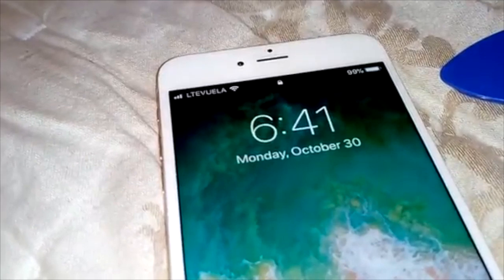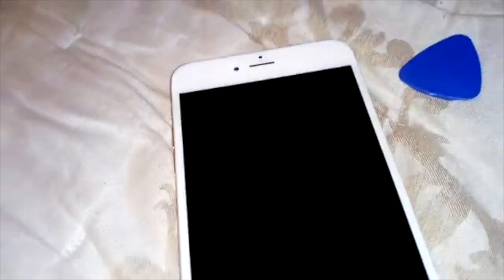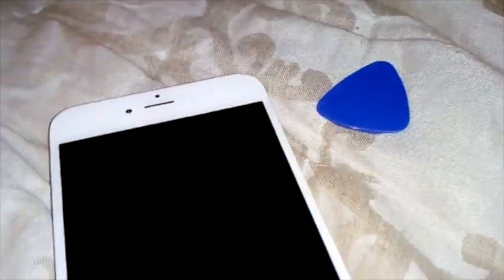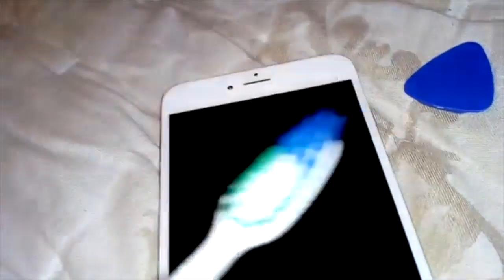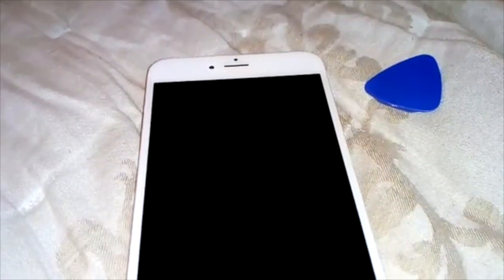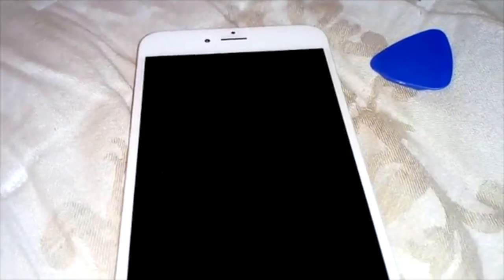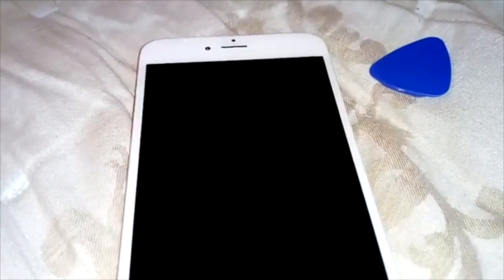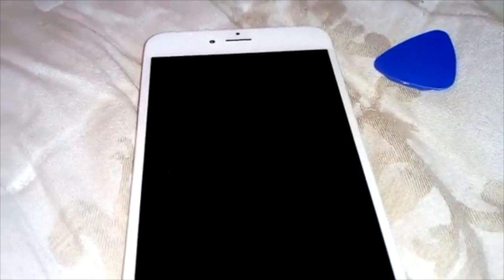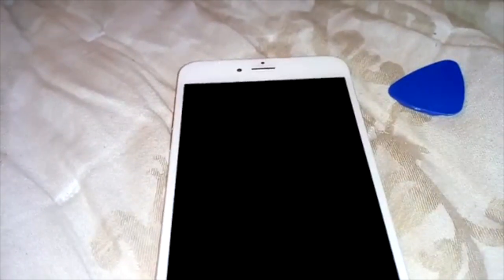Literally get rid of the jittering on top — no jittering on top. So I fixed my phone, and that's it guys. You can clean your phone while it's open, use a toothbrush, try nothing metal. And that's how you fix the jittering phone screen — the unresponsive screen, the ghost tapping. When you type like six, one will get pressed, or it just won't be responsive at all. That's how you fix it — you just got to clean the connectors and it's connected again.